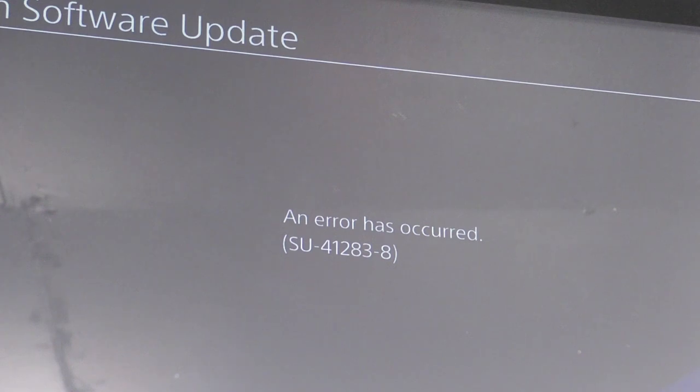So what we're going to do is we are going to dump the firmware from here. Luckily, I think I do have an old dump kicking around from back then, which we should be able to use to patch the firmware if there's a fault in there. And from there, we can try and re-upgrade it. If that still fails, then we'll have to replace the module on this board, and hopefully that'll work.